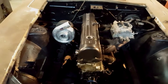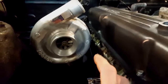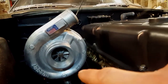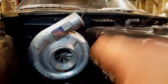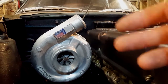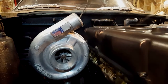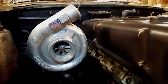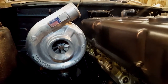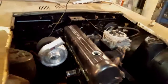That's where you get that flutter sound from. You can imagine that's pretty hard on the bearings, because that thing's spinning at incredibly high RPM. It's spinning and then all of a sudden pressure goes back into it and causes it to stop — it doesn't stop completely, but that air forces the turbine to slow down drastically, and that's where you get the flutter sound. So it's not good, but it's also not that bad — you're not going to kill your turbo right off the hop.